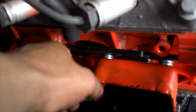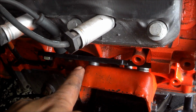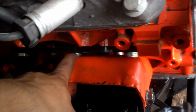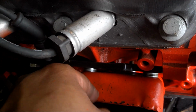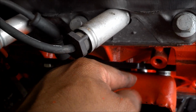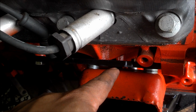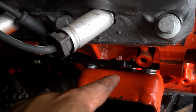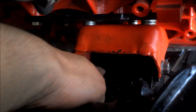But that'll be a separate video. But these are 1-inch setbacks off of Car Shop Inc. With, I got three washers holding it, putting it together to give it some clearance for the crossmember and pan. It's got the CTSV pan on it. It's about a quarter inch more lift on it with these three washers. I measured them out. They're a quarter inch spacer, basically. It's got new frame mounts.